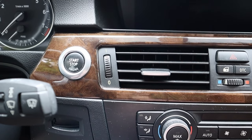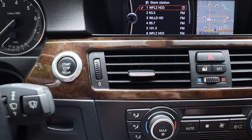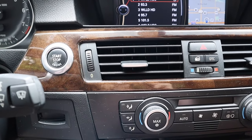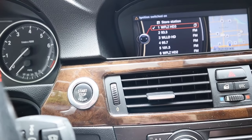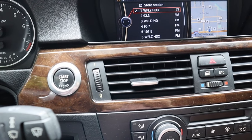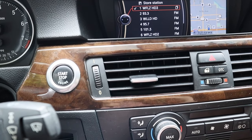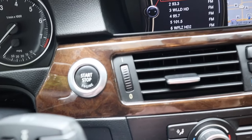Have your key and start the car without putting your foot on the brake. Then hold down on the accelerator pedal for about 10 seconds — you're going to hear some stuff going on in your engine. Wait about 30 seconds, then turn your car off. I would do that same procedure one more time for another 30 seconds and see if that works.